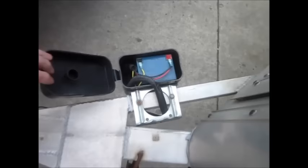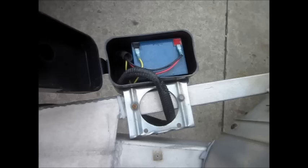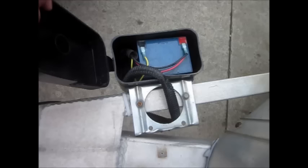Today I'll show you how to get power to your trailer hitch connector. This is a 2006 Silverado, and what I need it for is on this trailer with electric brakes — this safety battery that powers the trailer brakes in the event of a breakaway needs to charge off of the truck, and it comes off of that 12-volt pin in the 7-pin connector. However, when it comes from the factory, there's no fuse in there, so you don't get any power to it. I'll show you how to fix that problem.